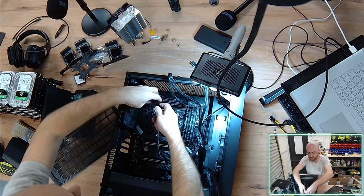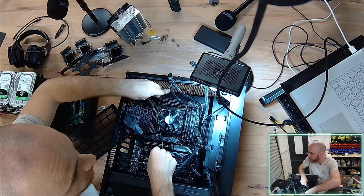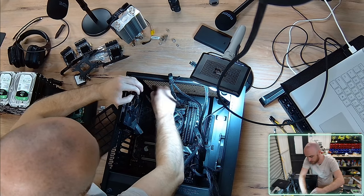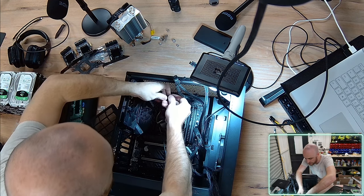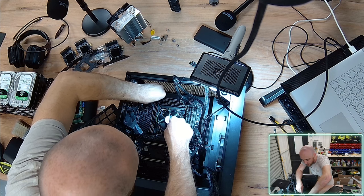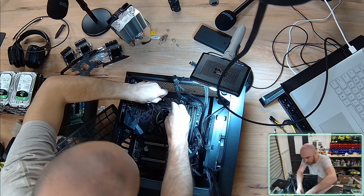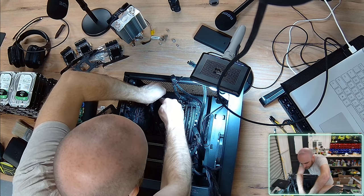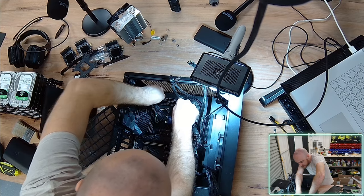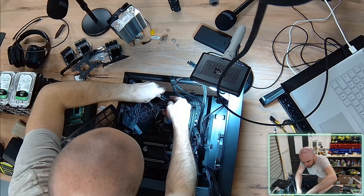Okay, so these are my CPU connectors, case fan. I'm just gonna go ahead and install. This motherboard requires two CPU cables to go into the motherboard to provide sufficient CPU power. I'm going to install them and then push back the cables through to the rear side of the case for cable management. Yeah, as if cable management's a thing for this. We've already discussed that this is not the prettiest install.